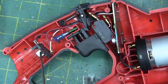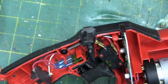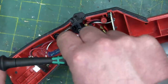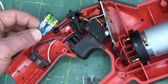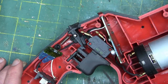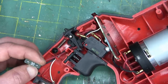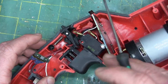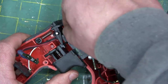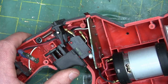Off the hop, the mildly annoyed pixies start their choreographed dance over here. You can see it goes through a craptacular micro switch. What's interesting is that there's actually a micro switch — we would see this in a crappy game or something, not in a proper tool. And a fuse — just an automotive fuse, 30 amp automotive fuse. We glean into the mind of a value engineering proposition here, where they are not putting the components they would typically put in a drill. This is very light duty construction. The trigger mechanism itself is just relying on the detent of this micro switch, and then there is also a latch. No dead man here. If this vacuum takes off on you, you're in trouble, partner.